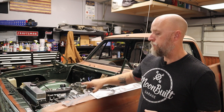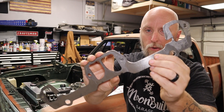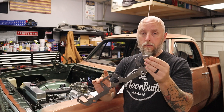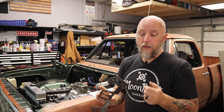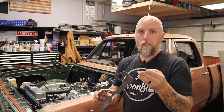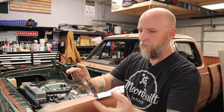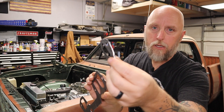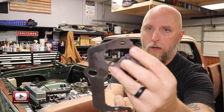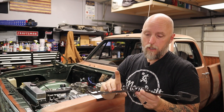When I pulled the header, I looked at the gasket I had installed. It's not a metal gasket — it's a material with a honeycomb pattern to it. When I pulled this, it was damp around the forward and rear most exhaust ports. I don't know if that was from when I pulled the bolt and they got wet, or if it's an indication it was leaking while running, which could have caused an exhaust leak at those ports. Also, looking at the forward exhaust port, there's some damage to that gasket. It was wet pretty much all the way to the edge on both the front and back exhaust ports, so those might have been the cause of my exhaust leak.